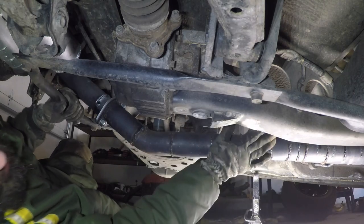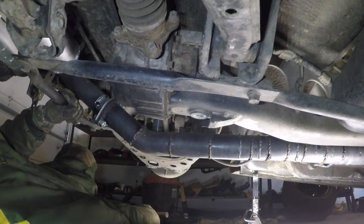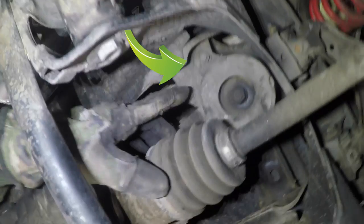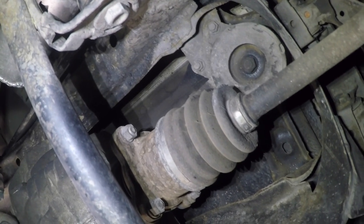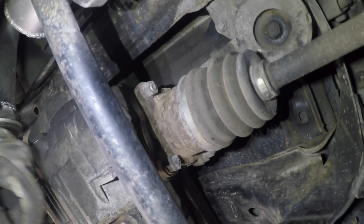With the PPF, the driveshaft, and the CV axles out of the way, the only thing left to remove is the actual rear diff hanger bolts. We're going to pull those nuts off. Those look like a 10, this looks like a 17 - same thing on both sides. Pull these loose. Make sure you have a jack underneath the differential itself right about here, so it doesn't fall under its own weight, because once those are out, there's nothing left holding it in.